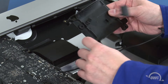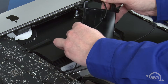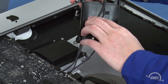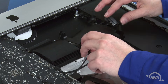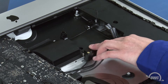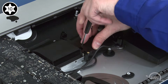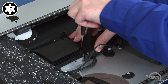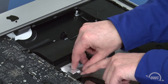If the wires on the back of the drive bay came loose, you'll need to reroute them. First, route the thinner cable through the guides, then the thicker one. Set the bay into place and tighten the screw part way to hold it while you make sure the cables aren't pinched underneath. You can then tighten the screw fully and run the two SATA cables and the speaker cable under the metal clip by the heatsink, adjusting them so that they sit out of the way.